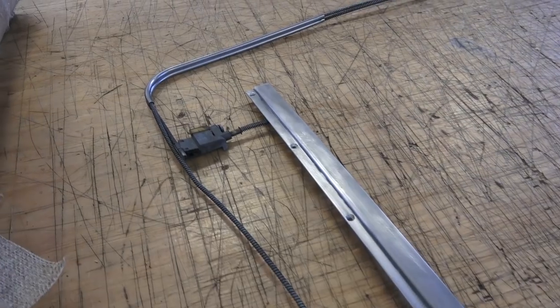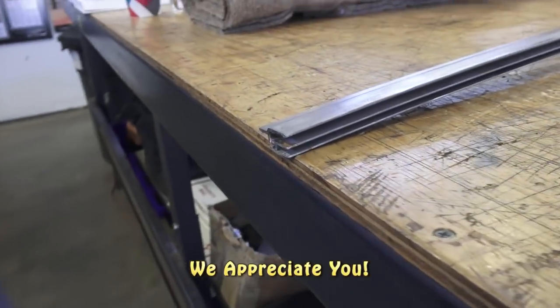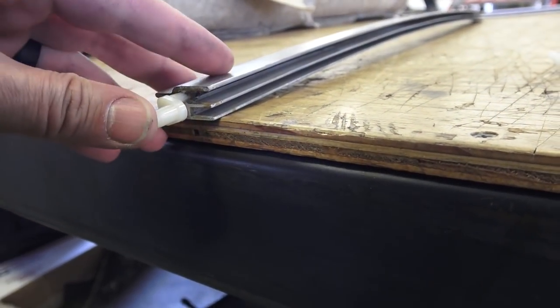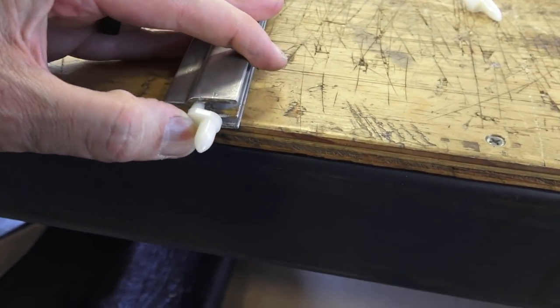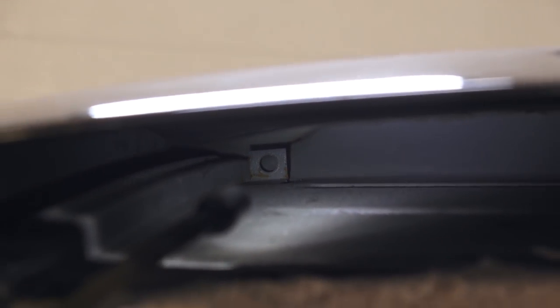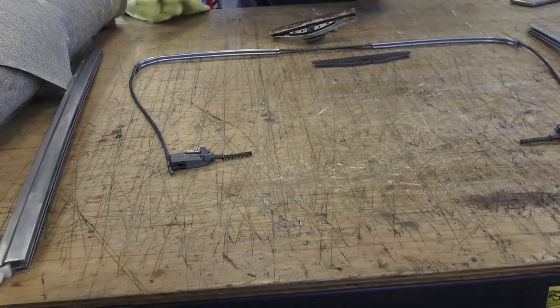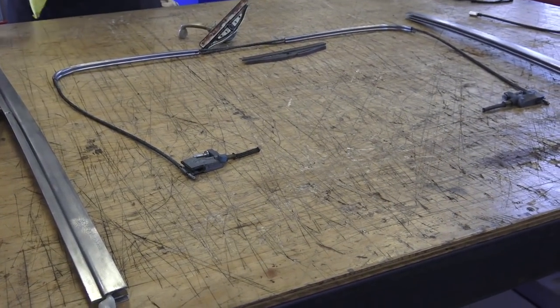Here is the steel rail that we had out. Like in the previous video, we spoke about how we just polished it up and cleaned it to make it look good — we didn't paint it. You've got to make sure these butt ends go into the end of the rails, and it goes into a hole in the back of the roof. That keeps the rail stable from moving side to side and lines you up correctly with the screw holes later on.